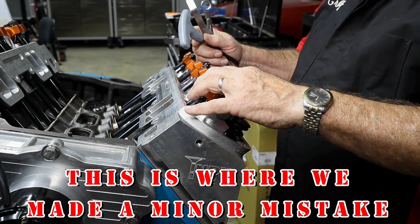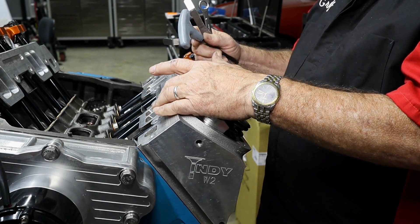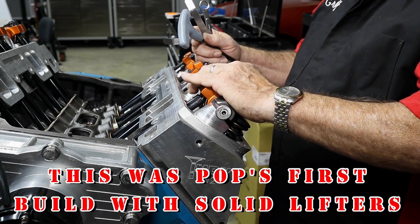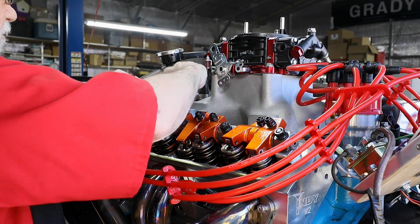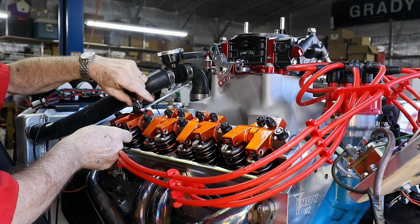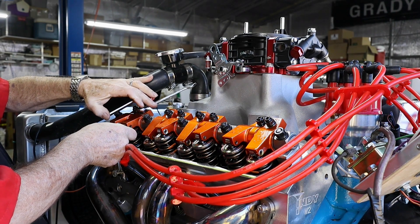So you'll hear a little noise when you first cold-start this — you're going to hear the valves making a little bit of noise, but it's supposed to. Once it heats up to full operating temperature, which for this motor is 160 to 180 — we're actually going to run it at 180 with a 180-degree thermostat — the water pump's going to keep it pretty solid on that temperature. Once that expansion's gone, you'll lose all the ticking noise you hear when you initially started. So they were at 16 and 18 — 18 on the exhaust, 16 on the intake. And apparently it opened up to 22 to 24 range, so we are bringing these down significantly.